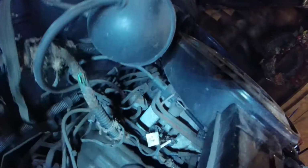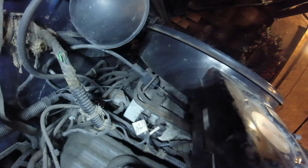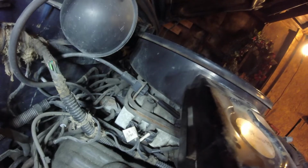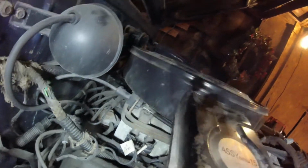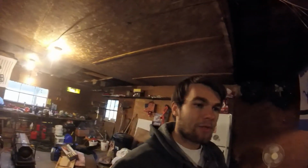And then on the rail there's a spot back in here. You can't really see it, but you can see a little bit. There's two soft hoses in there that aren't clamped or anything. They're just kind of pressed on. I'm going to take those off and actually hose clamp them on. There should be a bubble flare fitting or a barb underneath there. If not, I'll put one on and then actually hose clamp two high pressure hoses there. And on the return, of course, it'll also be flared so the hoses don't blow off.